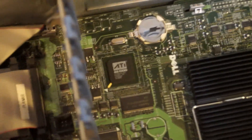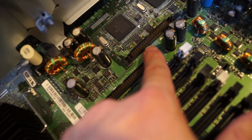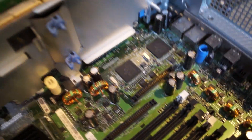Just some other little things: there's an ATI ES1000 — it's just a little ATI video card with 16 MB of RAM. There's a CMOS battery. 12 DIMM slots. These two slots here are quite interesting — they're for a DRAC5, which is a Remote Access Card for Dell servers. It basically allows you to administrate the server externally without having to do remote desktop, which is a very useful feature.